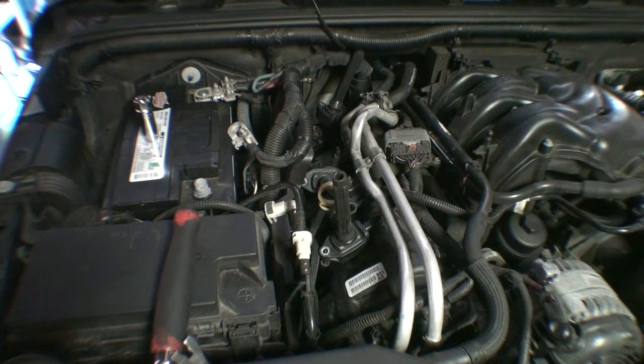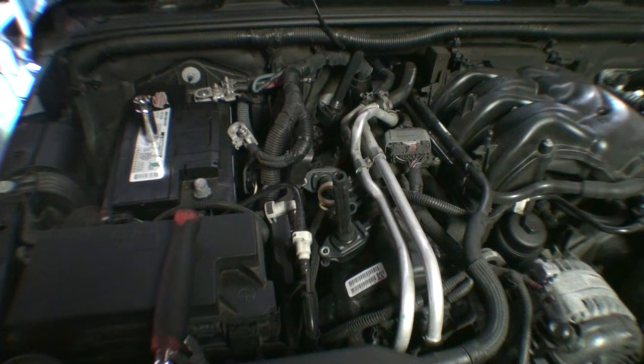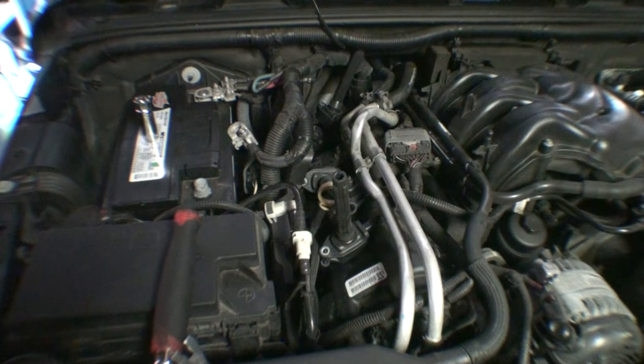If you use a fatter one and try to shove it down there, you can damage the spark plug tube walls, and that can cause leaking. Another thing to note as well is the spark plug torque spec on the Pentastar engine. This is directly from the factory. It's either 18 newton meters or 13 foot-pounds of torque.